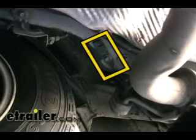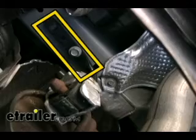Starting underneath the vehicle, the first thing we want to do over here on the passenger side is go ahead and lower the exhaust down so we can gain access to the frame rail. To do this we're going to lower the exhaust down off its two rearmost hangers — there's one here just forward of the muffler itself, and if you continue forward on the vehicle just in front of the axle there's a second hanger there. These two hangers are both bolted to the frame, so we can just unbolt them.